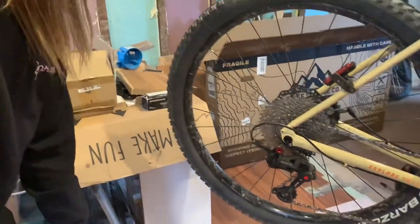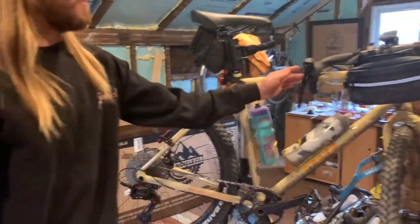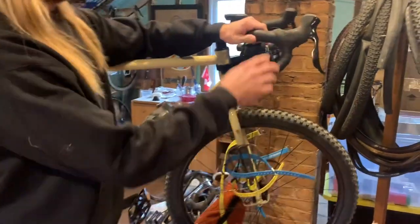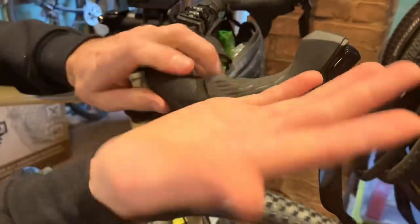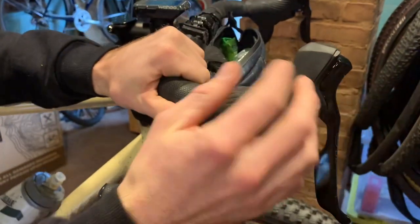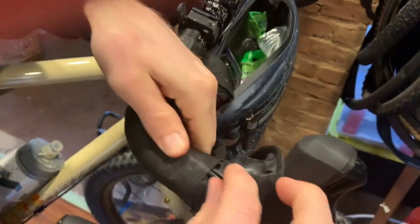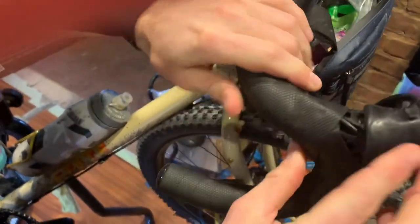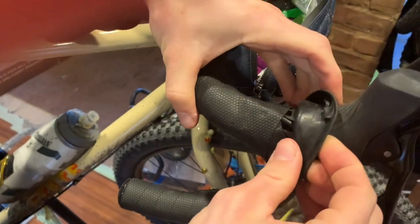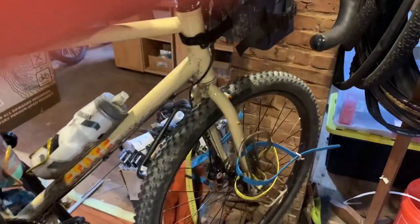The indexing isn't perfect but it's rideable and pretty close — something I still need to work out. The bike also shipped without a ferrule on the end of the shift cable, so it's a bit frayed. Additionally, there's a big lump where the cable comes out of the shifter, right at the base of your thumb muscle, which is very annoying. I need to see if that's a poor assembly issue or part of the shifter design.